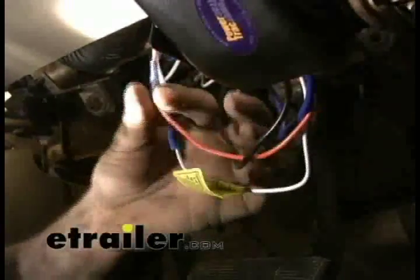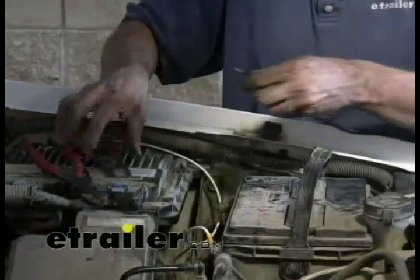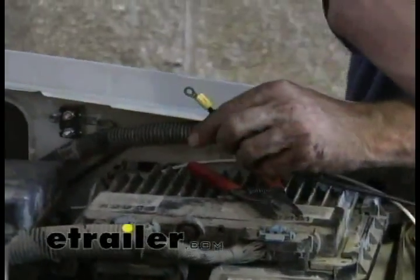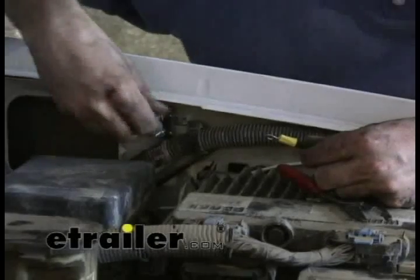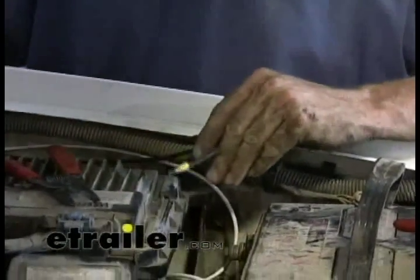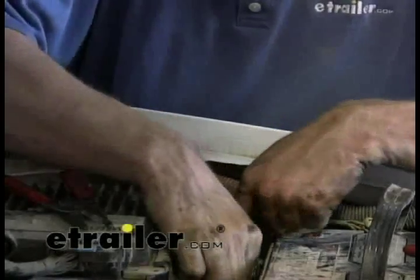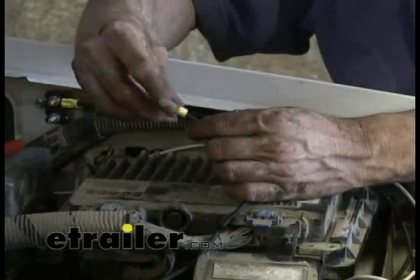Let's go back and run our power lead — the 12 volt black wire. We'll run this from the battery to the terminal labeled 'battery' on the circuit breaker, and we're going to leave the other end loose for now. This end will stay loose; we'll make this our final connection when we're done. That way you don't scrape against the frame or anything like that and cause a short. Then we'll make our jumper from here underneath the dash.